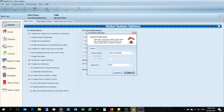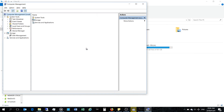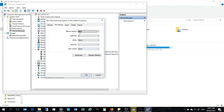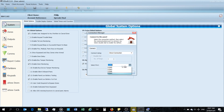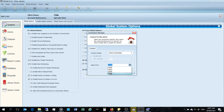I'm going to show you how to find the correct COM port. Go to My PC, right-click and select Manage, then go to Device Manager and look under Ports (COM & LPT). You can see the IDS USB Download Station, which is the serial-to-USB converter. In Properties under Port Settings, you can see it's on COM 4. If you use the wrong port it will say 'opening COM port' and then 'could not authenticate.' So let's reconnect on COM port 4.